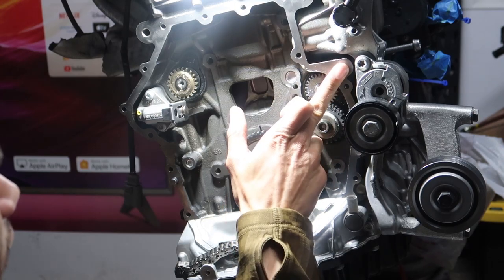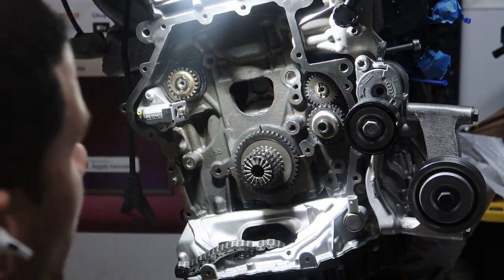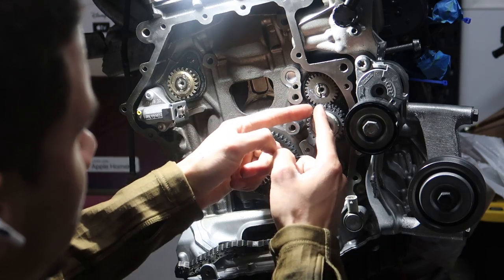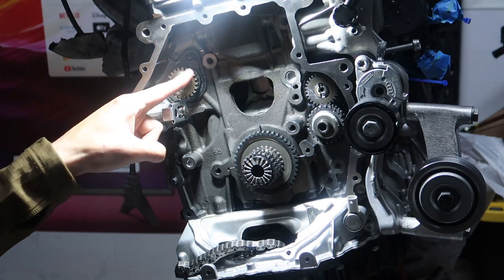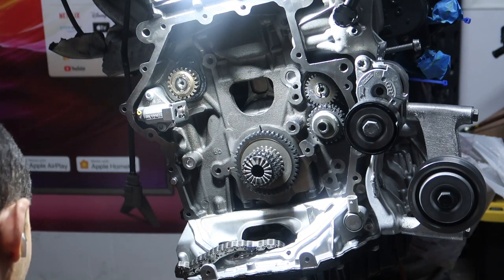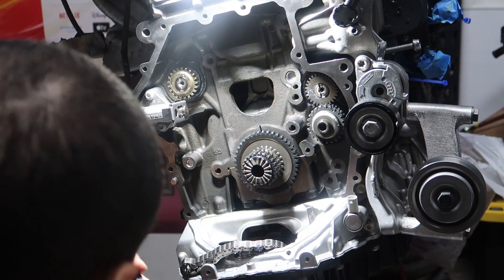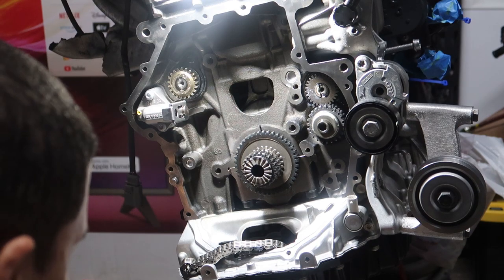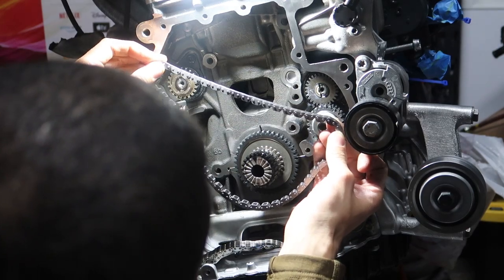Yeah, if you're reading through the book, you'll know there's no real point in explaining it right now. Unless you're trying to do this yourself, then, well, you got the two bottom markings and the single on this balance shaft, right in between, which puts the other target mark there, and this one in the book looks like it's going towards the bolt, kinda. So, there's that. So let's take the chain, find the different colored ones. Okay, so we got a couple. I'm gonna assume it's like these two, maybe. This one and that one.